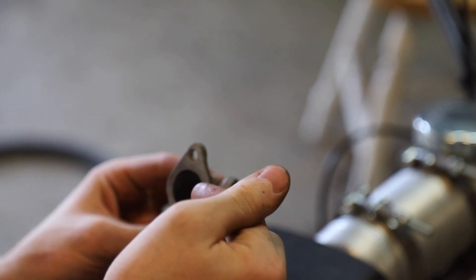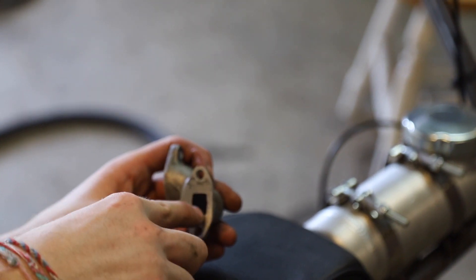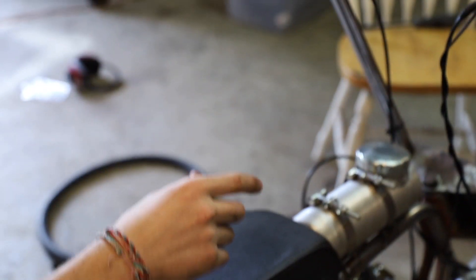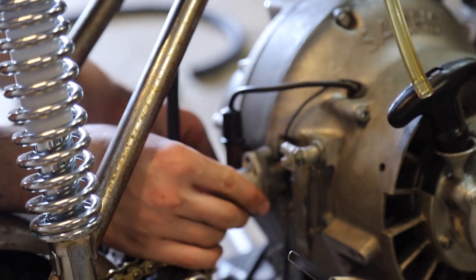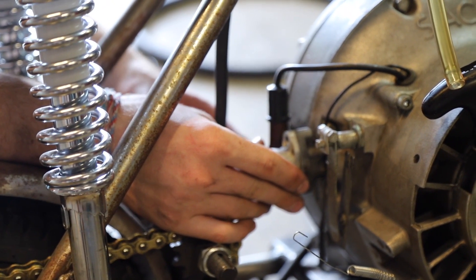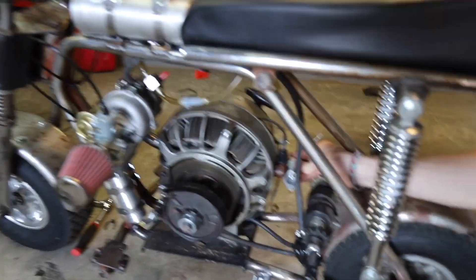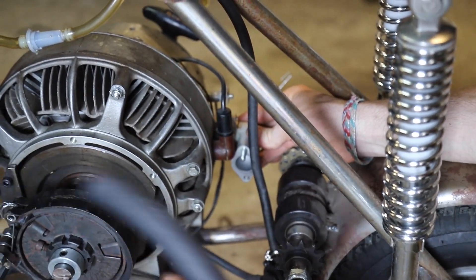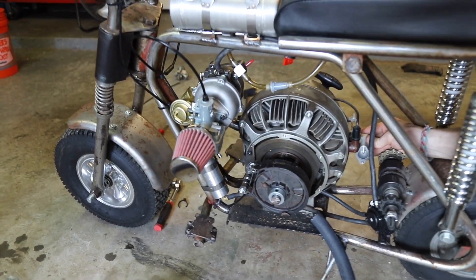This intake runner from Sax is actually really nice - it's got a nice step down, it's smooth, and it would be better than putting a large pipe into this tiny hole. We'll just flip it around and it fits pretty much perfectly. We'll have to make a custom flange, but after that's really all the hard fabrication we need to do. We'll have a flange, then a boost hose, and that goes all the way over there and we're done.